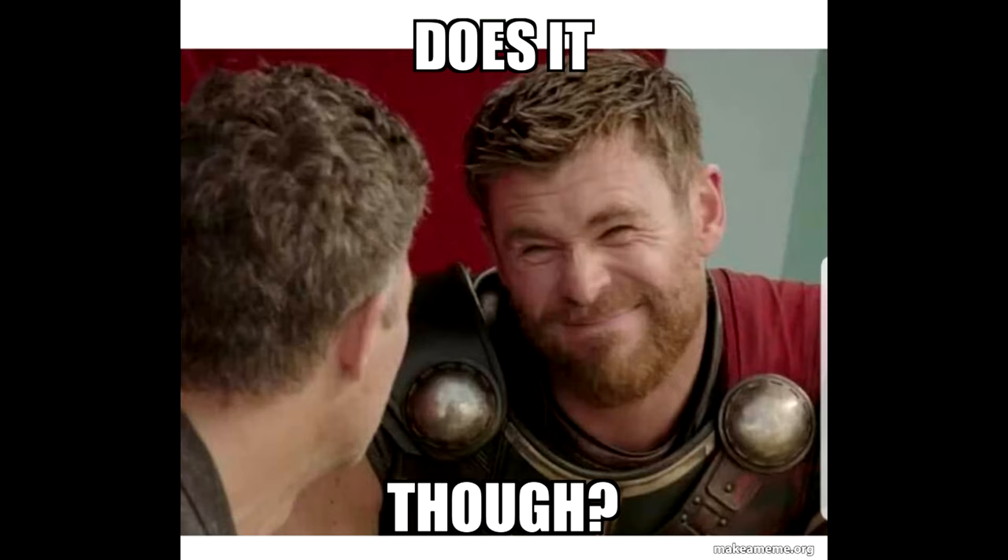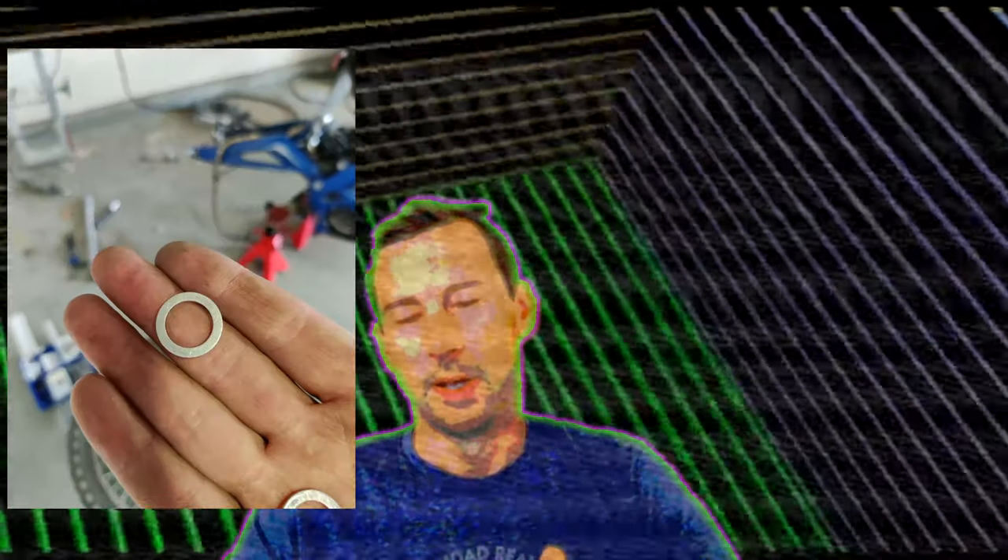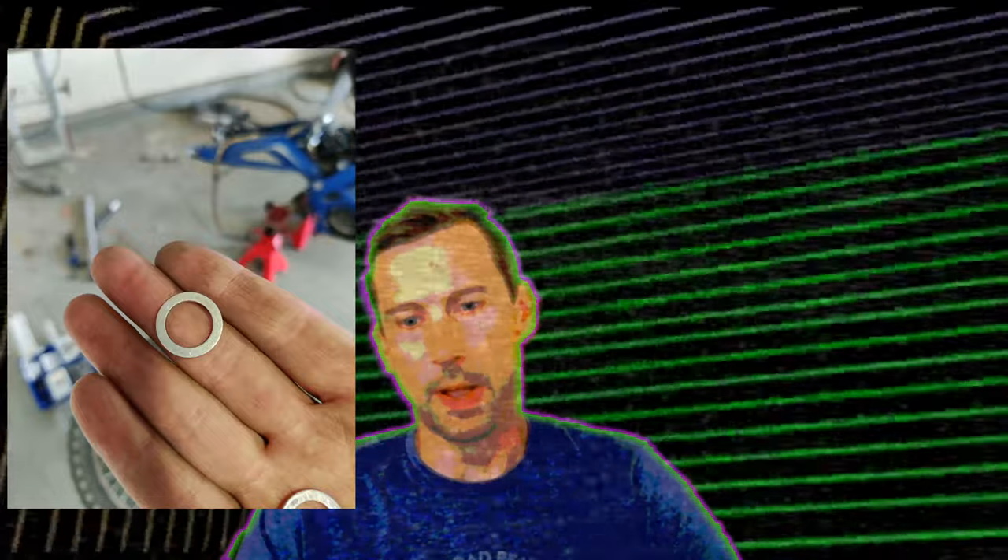Okay, this is getting frustrating, but I have one more idea. I'm gonna grind some more. Please work. Does this one work? Yes! The answer to that question is yes. But there was one caveat — I did end up using a small washer that actually helped effectively line up the caliper better with the rotor.